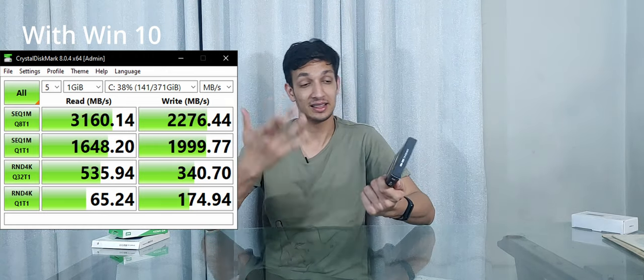It's been about a month since I've been using the Samsung 980 SSD, and the performance has been blazing fast — there's no ignoring that. It can go up to 3.5 GB/s, which is a crazy number. Just to give you an idea: if you're coming from a WD Green or a cheap SSD like the Crucial BX series, it's going to be night and day, because those don't have DRAM caches, so in some aspects they are very slow.